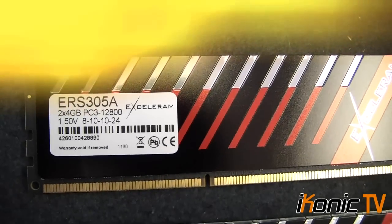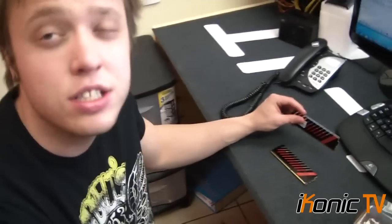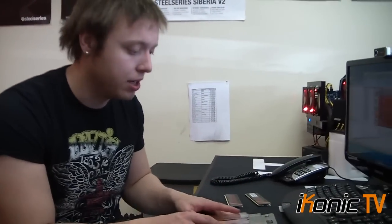The CAS is the main read and write timing. So if that is the lowest, it gives you a good indication of what the memory is. Because that is an 8, this is what you would call CL8 memory, which makes it a lot faster than, say, CL9. We'll look at the benchmarks and I'll explain it in detail a bit later.